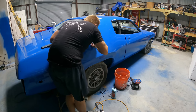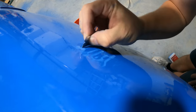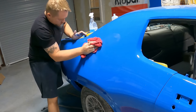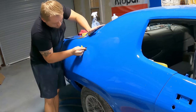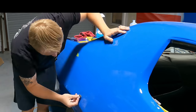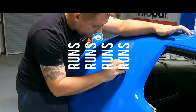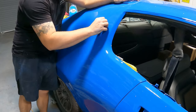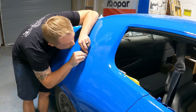The first thing you want to do is cut the heads off of the runs. You'll want a lot of razor blades — I bought a pack of 50 and then another 50 for 100 total. Make sure the razor blades are extremely sharp; if they're dull you'll dig into the panel and leave gouges. After cutting the run flat, take your razor blade sideways on the panel — if the run goes up and down, tilt the blade at an angle. That's how you scrape them smooth. You don't want to go too far, just far enough that the sandpaper takes care of the rest.